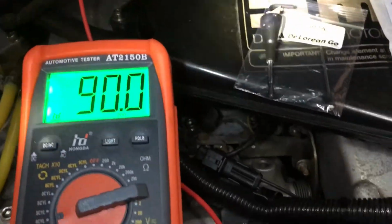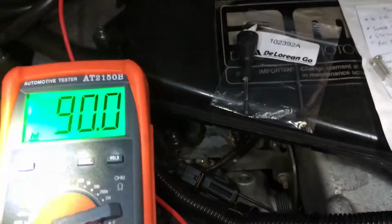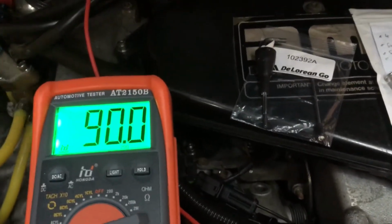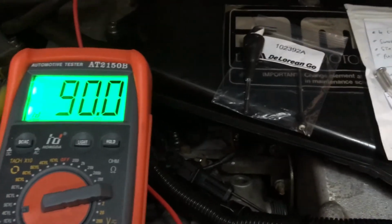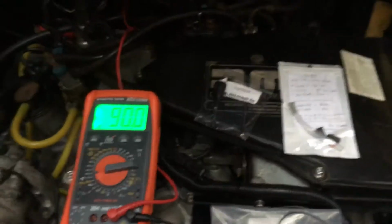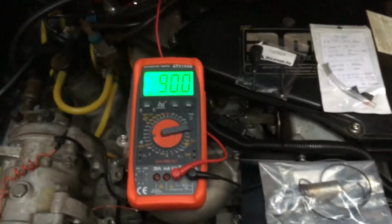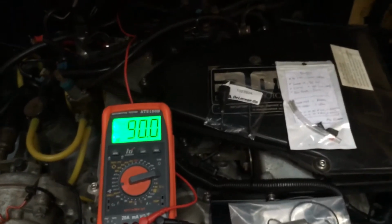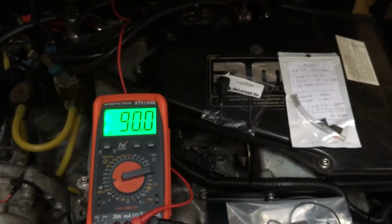So I was able to then turn it anti-clockwise, millimetre by millimetre, using the Allen key, and I actually used a set of pliers on top just to turn it really carefully, and managed to get it running between approximately 35 to 45, that sort of area. Yeah, and then all pretty sweet. Once I'm happy with that, I revved it a few more times to make sure it's still settled. If it doesn't, you can adjust it a little bit more, either way.